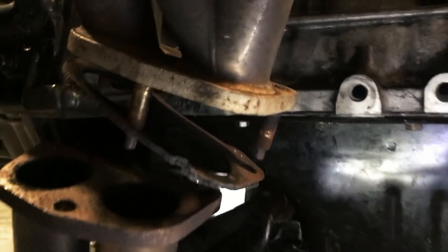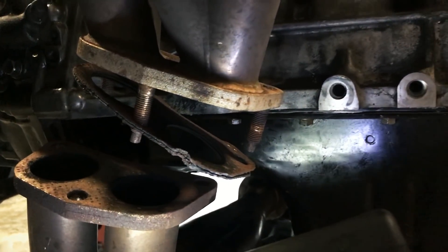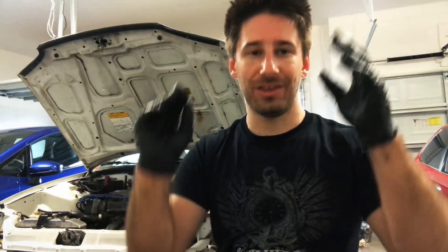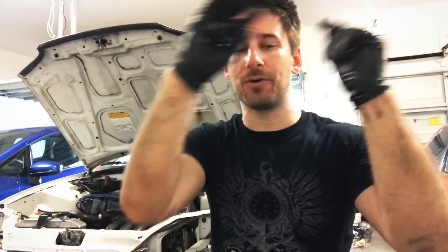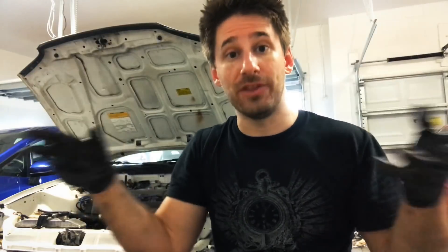Everything's tightened back up. This is kind of a weird job — don't just go in and tighten one bolt or nut down on the oil pan all the way and then do the others. Do that star pattern two or three times, keep going around and just check them. Look at the gasket going around — make sure it's not bellowing out over the edges of the oil pan. That's how mine looked before and it was just a leaky mess.